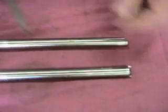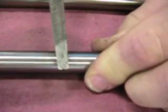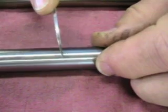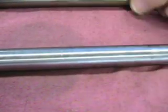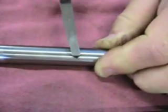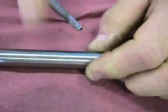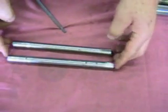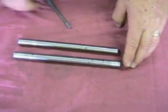I'm going to test both of these with a file. I'll take this one and cut it. You can see I've made a very definite cut with the file — this is too soft. Now I'm going to go to a more original shaft and cut it. He is hard, I can't cut him. So before you fit your lay shaft to your gearbox, try to cut it with a file. If it cuts, it is too soft — don't use it.